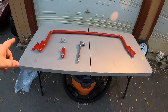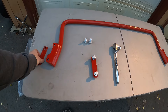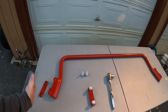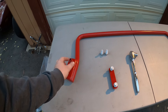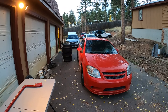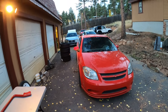You can always make it better, and this is ZZP's rear sway bar kit. It's almost like a beam stiffener in a way with how that suspension works. The way I have it laid out, this is how it goes underneath the car — it goes underneath that beam. There should be a piece of metal where the spring sits where you slide this piece in, it sits in between, and then you just put the bolts in from underneath. You shouldn't have to take the wheels off or do much — just jack the car up. The smart thing would have been to do this before I lowered the car, but let's make it more difficult.